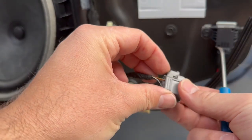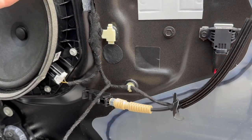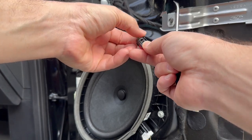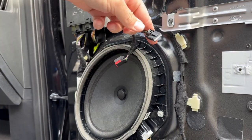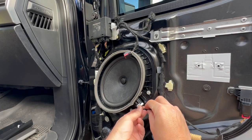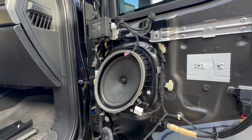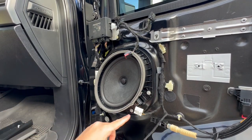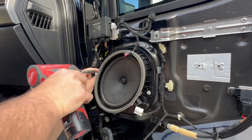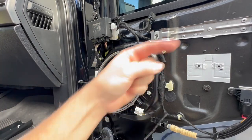For your other connectors — your gray connector has a little push tab here, and up here same thing, little push tab. The last one also has a little push tab, which makes this pretty easy. Now to pull the speaker off, same thing — push in, pull it out from the bottom, and then it's got four 7mm bolts on it. Let's not mix these up with all our other ones for the rest of the door.